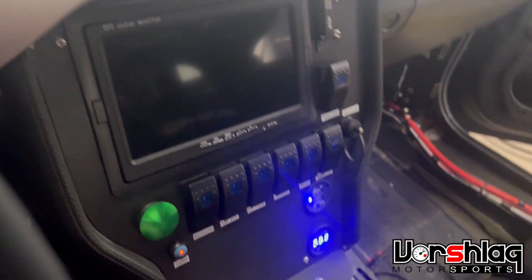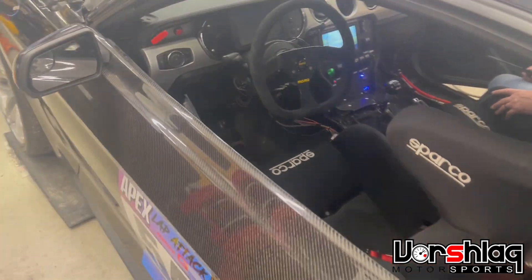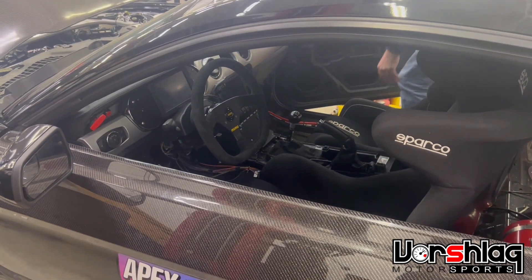Right here we have the car tech kill switch, and as soon as that's on we have electric steering. The car can just be pushed and we can turn that on — you can't do that in stock form. It has to be engine running, but it comes in really handy in one of the many EPAS swaps we've done.